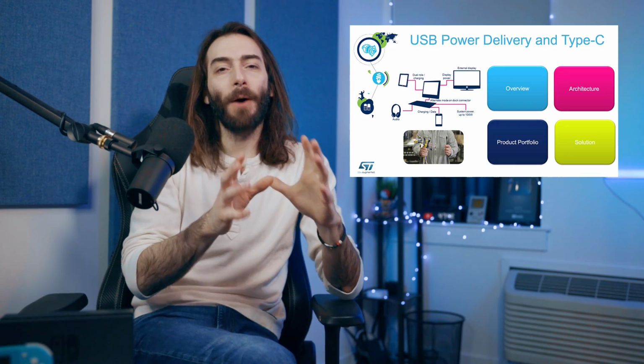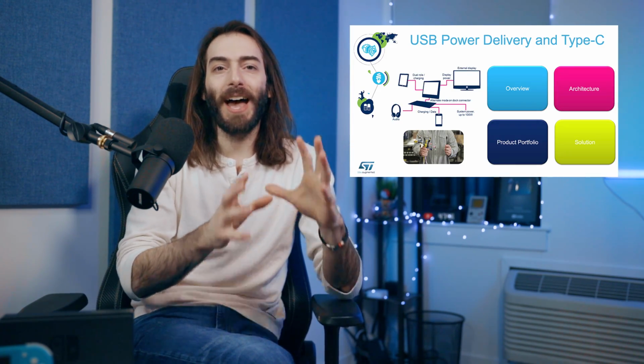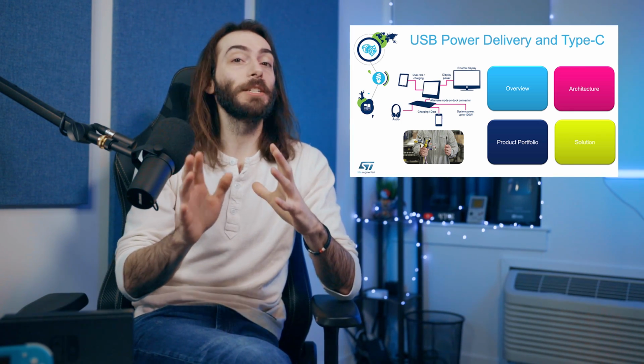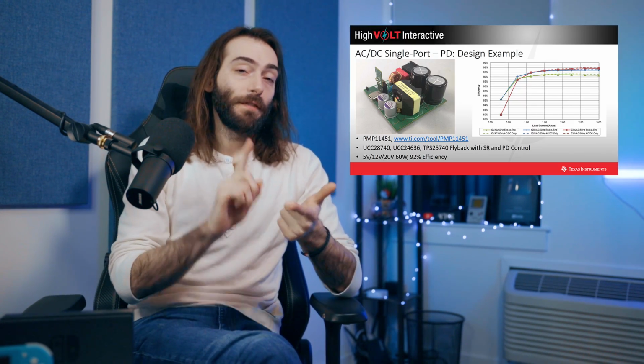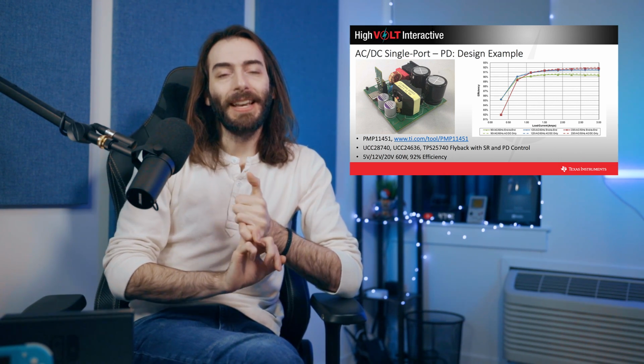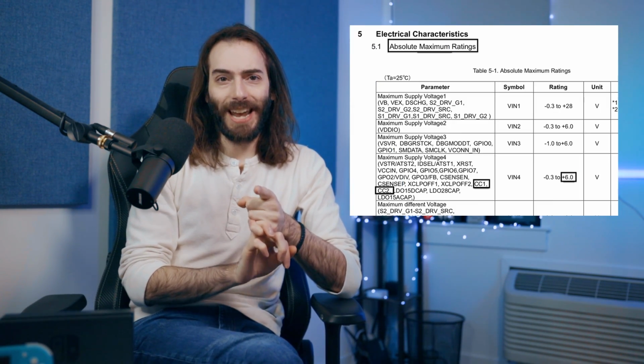In order for all of these different devices to use the same standardized cables, the USB power delivery protocol was developed so that you don't accidentally plug your USB-C device into a different USB-C charger and fry it. The power delivery standard accepts 5, sometimes 9, 12, and 20 volts. The Nintendo Switch says, "F your power delivery standard, we're gonna use 6." This is where things get technically confusing.